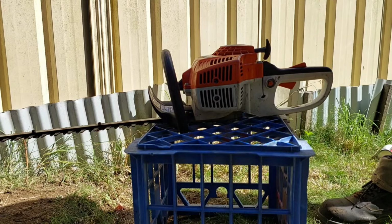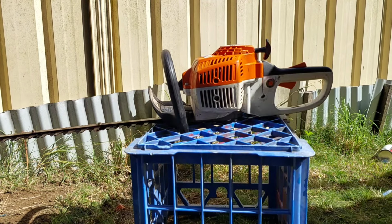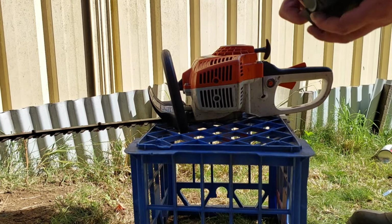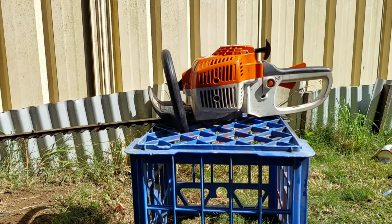Things, guys, always put your air filter and stuff back on before you tune them, because it changes so much. The air filtering system on these is quite dense, so air can't get through that well. It sounds right now, but once you put all this stuff back on, it'll run even richer. Put it back on, and I'll start back up and I'll get back to you. Hang on. I'll tune it up.